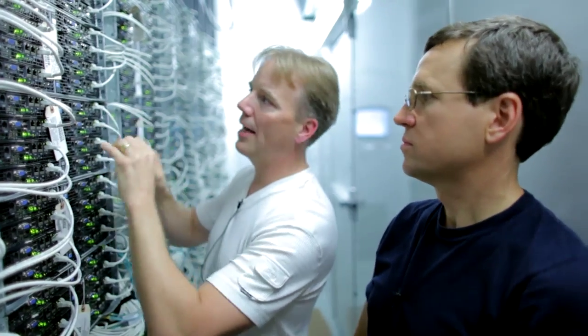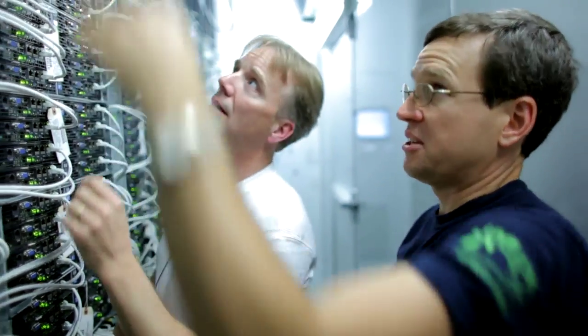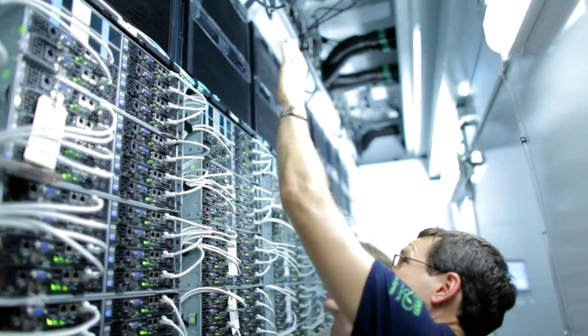The overall capacity is 600 kilowatts of IT load based on the cooling. There are two servers per slot, 96 servers per rack. It's a 50U rack integrated with a 12U rack, so I actually get 62U, which allows me to get rid of the facility-level UPS. This one's running one of our test loads, but we expect to turn it on for the customer so they can validate it and put their load on it before it actually ships out — running at 500 kilowatts when the customer runs it.